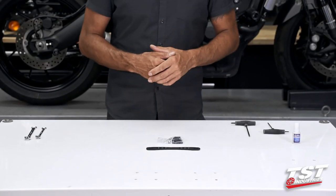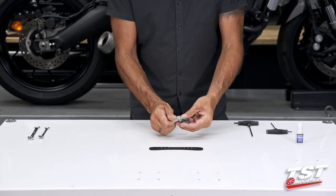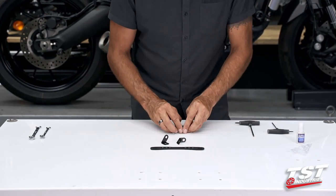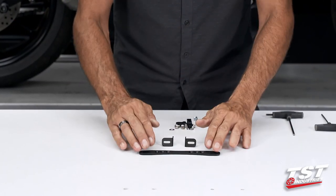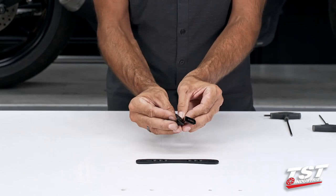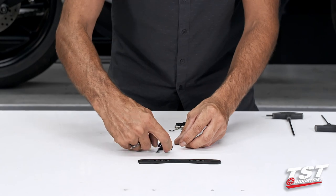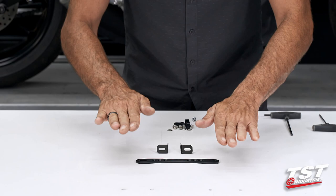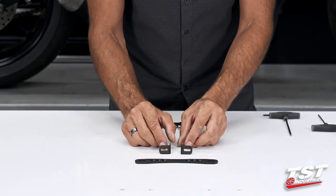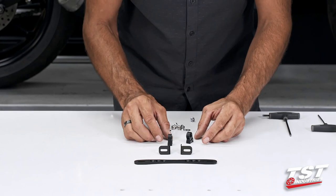The following will be the appendix I promised you guys concerning how to pre-build this set of parts into a pre-configured assembly. We're going to empty all the parts that come in the kit and situate the subcomponents. You have your flat bracket and then you have these L brackets — if you notice, they are not the same. They are actually mirror images of each other. What you want to do is have the slotted surface sitting up and the surface with the hole behind it sloping down. Imagining this is the rear of the motorcycle, they will be sloping towards the rear. Situate them so that these slots align with the innermost holes.